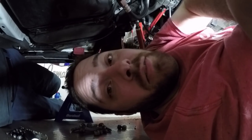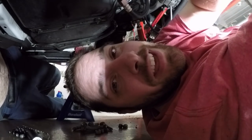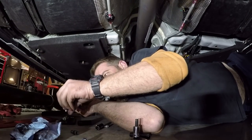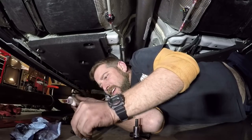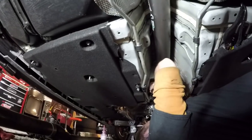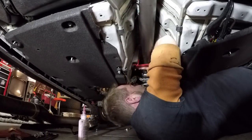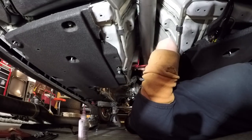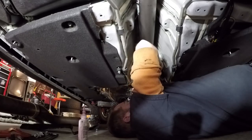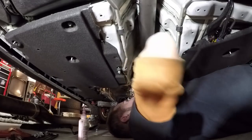Okay, if you're wondering what we're doing now, BMR suspension. I got my drive shaft loop, so officially finally putting that in the car. GM does do a pretty good job with theirs. They do have kind of a drive shaft loop in there, but it doesn't fully fill in the whole thing. Gotta protect those legs. So you can see BMR drive shaft loop. It's got four bolts. The Allen bolts you're putting in there? Uh-huh. And there is a washer. So you put the loop over your drive shaft, obviously, and then there's a bottom base plate that connects it and completes the loop.